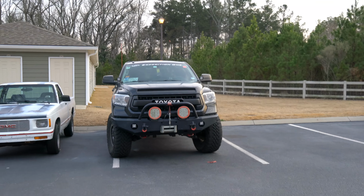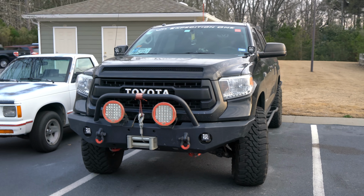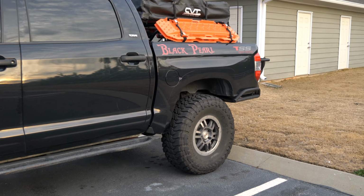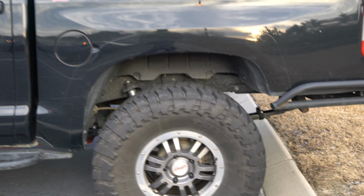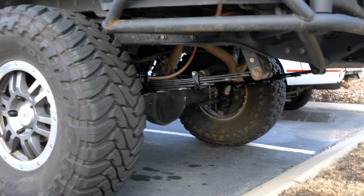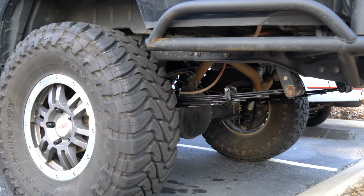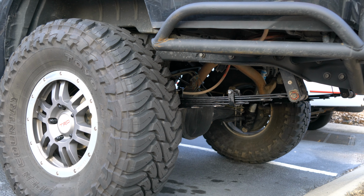Okay, so I just got done with the rear Atlas suspension leaf spring install. It's the plus 3 Atlas Expedition Pack leaf pack lift. So I just took numbers and just drove it around just now, and I guess some of the facts are that it raised the rear a little over 1 inch, like 1 1/8 inches. So it's perfect, exactly what I wanted.